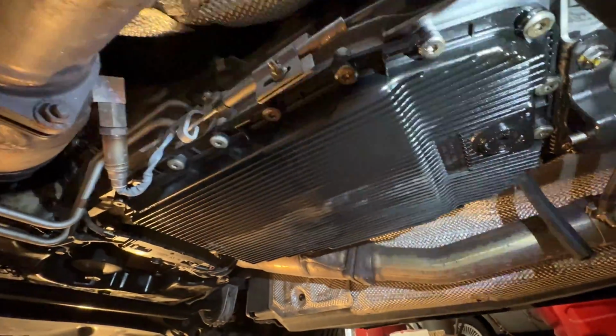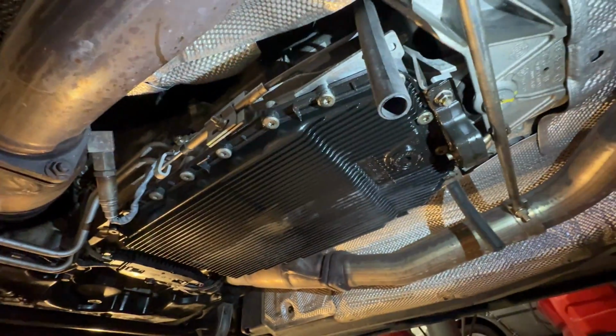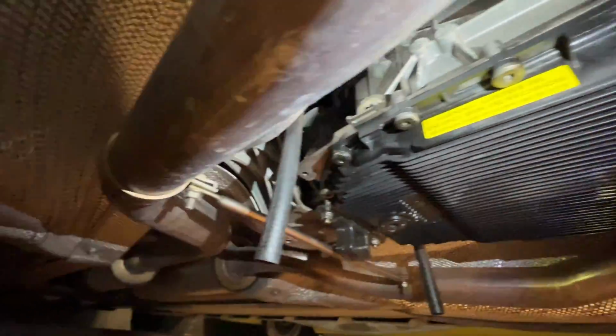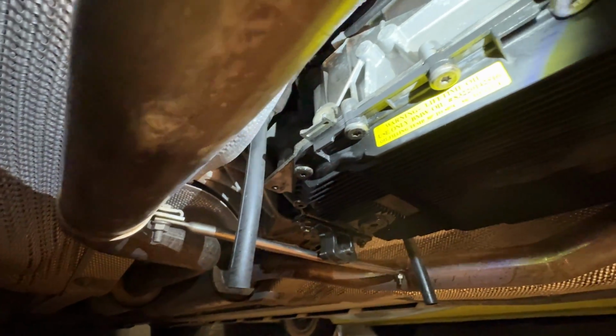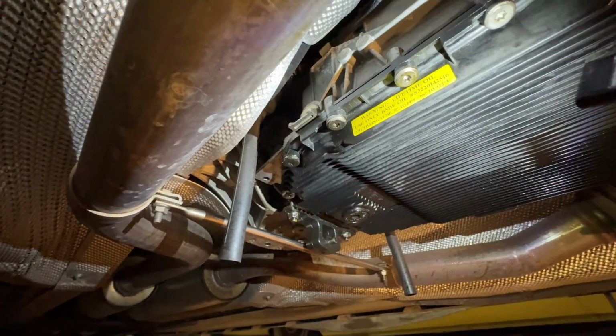The issue with doing a pan drop, though, is you change this whole filter out, basically. You just drop this whole thing, and this whole thing is plastic, and you throw it away. You put another one in, and then there's a sleeve you clean, and then you have to fill back in through that little screw hole up there, if you can see it. And you've got to have a pump. I was talking to Car Wizard about it, and it's kind of a pain in the ass.